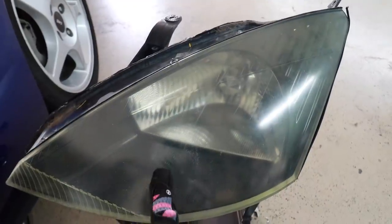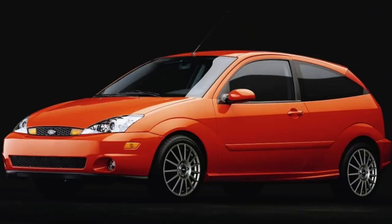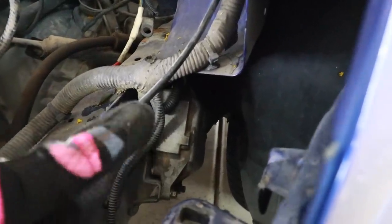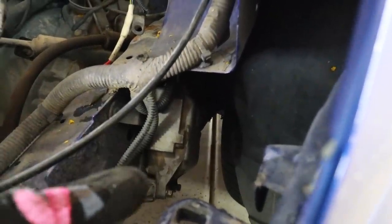If you're wondering what I'm going to do about the lack of a blinker now in my grille, I'm going to replace these with the factory EAP headlights. In case you don't know what EAP stands for, it's for a European appearance package — something they had in the States on the 03 and 04 SVT Focus that included HID projector headlights with a built-in blinker in the headlight housing itself. That dirty looking silver box thing is the intake runner control module, which is potentially bad on this car. I know it seems like I'm getting slightly distracted from the battery relocation, but I'm trying to be proactive and take care of stuff in the vicinity of what I'm working on.